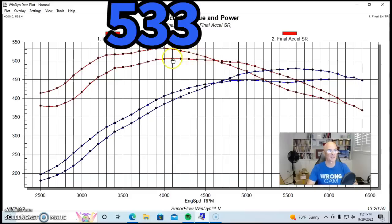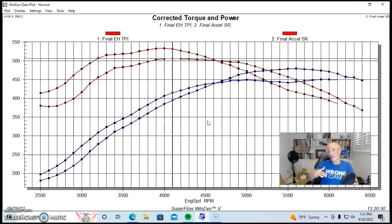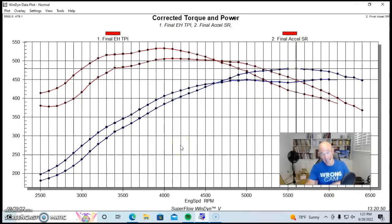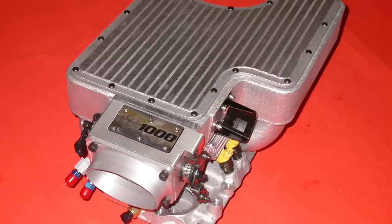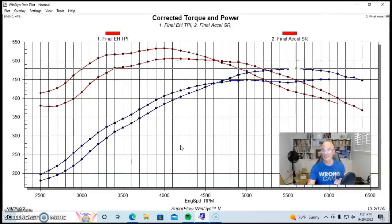Its shorter runner made less torque — torque came down from 533 foot-pounds down to 506 foot-pounds — and because of the shorter runner length it also made more peak power: peak power went up from 450 horsepower up to 479 horsepower. Exactly what we'd expect — less torque, more peak power from the change in runner length. There's also a change in plenum volume, but I honestly don't think the plenum volume had that much of an effect — I think this is predominantly a change in runner length.